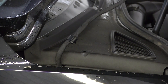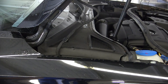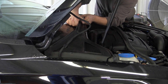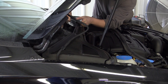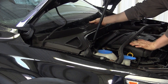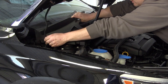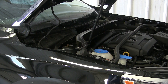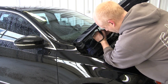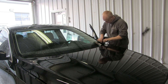Now, this is an easy windshield. A lot of cars — I'll show you a picture of another one he had in there — have cameras and sensors and all that stuff built into the windshield that plugs in. If that's the case, you will have to calibrate it. He said they're still sending that to the dealer for that, and probably a lot of shops are doing the same thing. Everything is going to need to be calibrated — windshields, side mirrors, bumper covers all have sensors. He says it takes a special room and there are some steps to it.